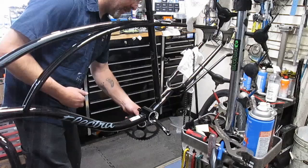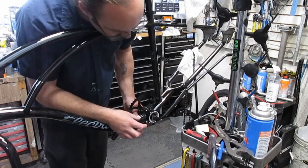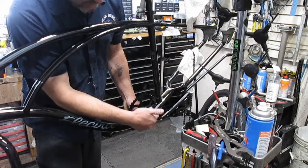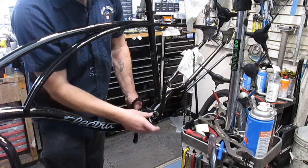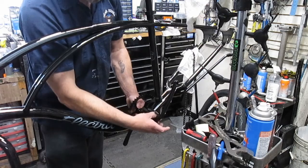Alright, so that's how I slid that in there. Make sure that when you put it in, the ball bearings are facing inward and the outer ring of the retainer is facing outward, on both sides. So you slide one retainer bearing on, slide the thing through and turn it around, put the other bearing in, slide the brace on there, and get the thread started. Don't force it, let it do its own work. And then boom, it's starting to thread on very easily.